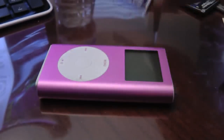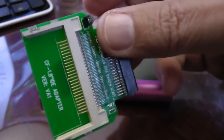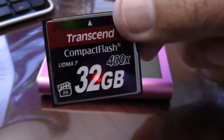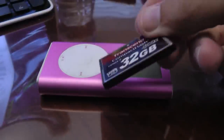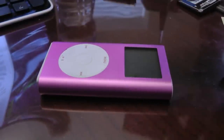There's no adapters needed. Some of the older iPod Classics need a CF card to IDE adapter to make them work, and they don't always work so well. But with a regular CF card, it will plug directly into the iPod Mini with no other add-ons needed.